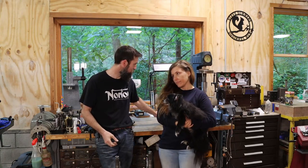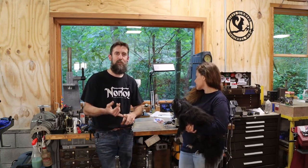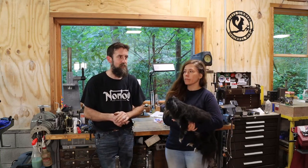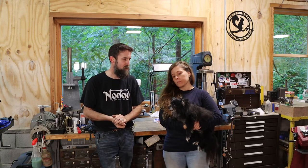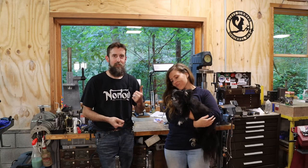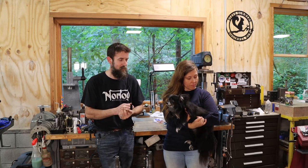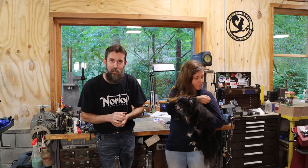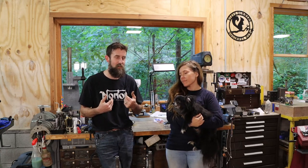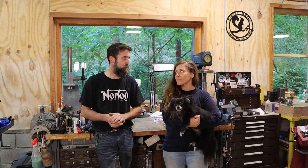I did decide to go ahead and put differential gears in it and wheel seals, along with obviously the back brake pads and turn the drums. Thankfully her car did not come apart while she was driving it. Luckily, it popped loose at the gas station, which is about the best place that it could possibly have happened. So we got really lucky on that. And we had the parts to fix it. It went well.